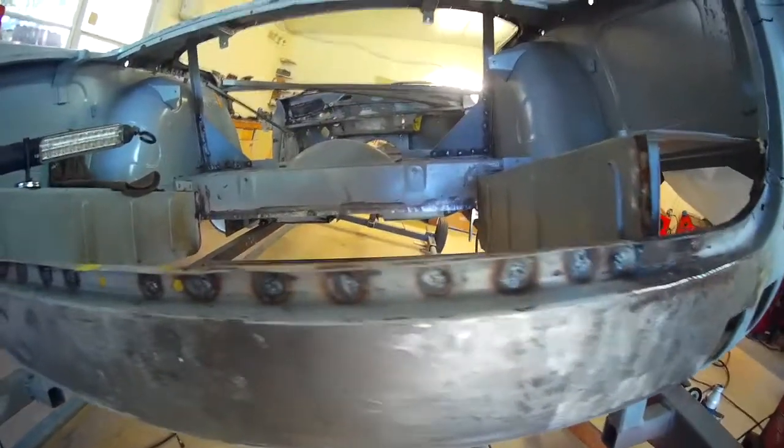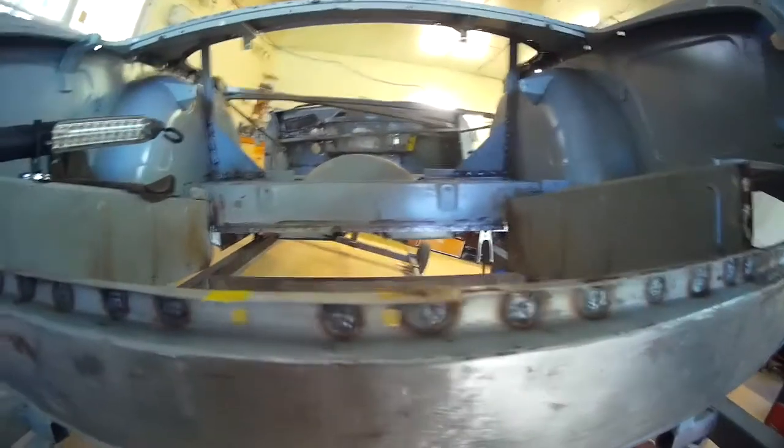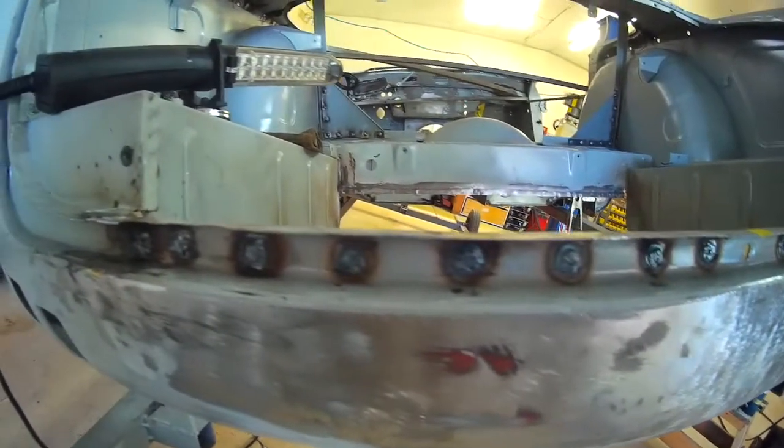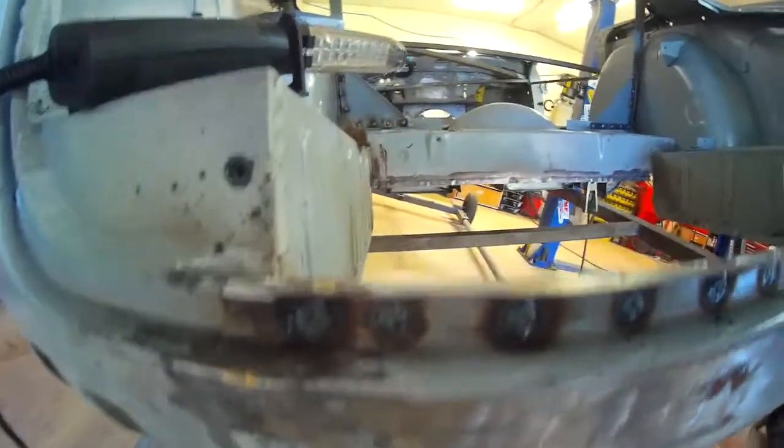This is the side with the aluminum block — it goes quickly, and as you can see the welds are not sticking out very much. Here's a second pass with the camera with a little more light showing the backside that I'll be grinding down. If you're wondering what the masking tape is for, those are two holes that are supposed to be there for the rear trunk latch. When I put the rear body panel on my brother's car I just welded everything up and had to find them and drill them back out, so I remembered to mark them on this one.